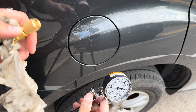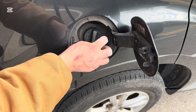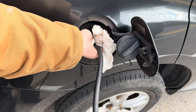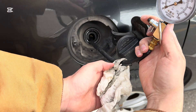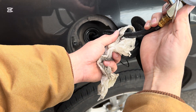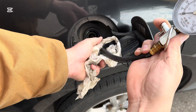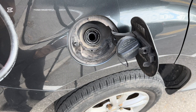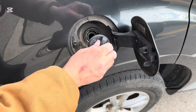Alright, so even though it's reading zero, you may have a little fuel still in the line. I just go back to my fuel filler cap and stick the test port side in. Then you have this little bleeder valve right here — just stick it at the highest point and press that. You might be able to hear that dripping in. Just wipe it up. All the fuel is gone out of here. I like to just take a bag and put it around here for storage just in case you have any droplets. And you're good to go.